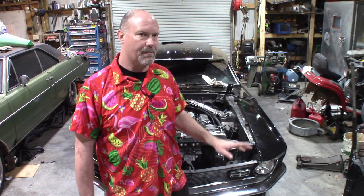I have done a few small upgrades. I did a shift kit on there and I upgraded to a 6-clutch forward drum clutch, I think is what you call it, direct drive, something like that. Anyway, again, I'm not setting it up for performance, but I'll show you how to set up the line pressure real quick.